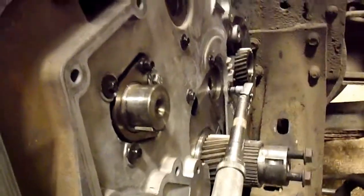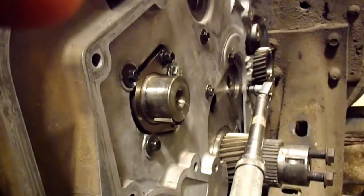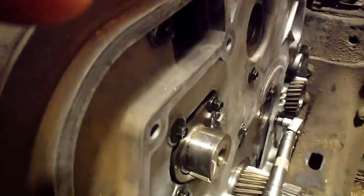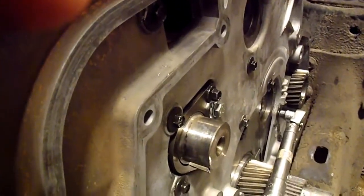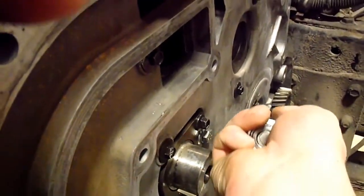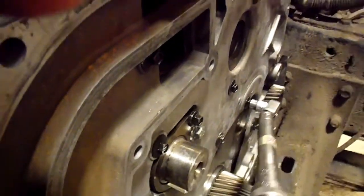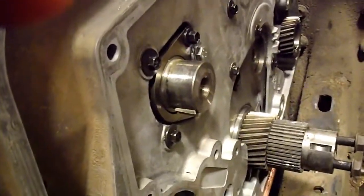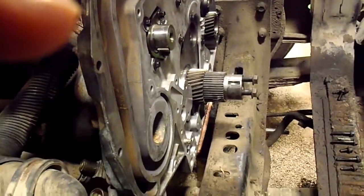Those are 19 foot-pounds. I found a torque spec online for those. And you'll want to go, of course, crisscross your pattern, torque them down, and then go through them one more time, because what you'll probably find is as the O-rings crush, you get a little bit more of a turn out of them. There we go. Nice crush. Grab me the torque wrench. Yeah, so I'm just working my way through those. I'm going to get them all torqued down, and then I'm going to start getting the timing gears in, and I'll show you the timing procedure when I do that.